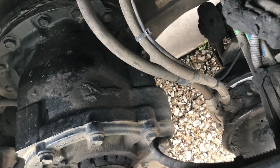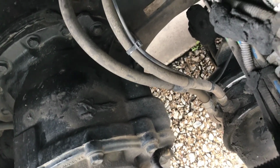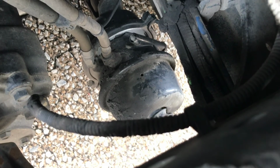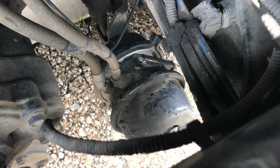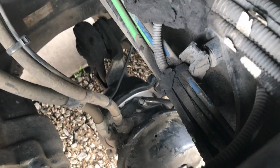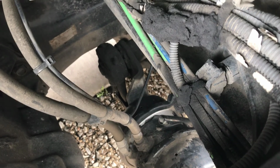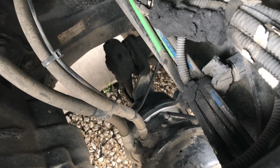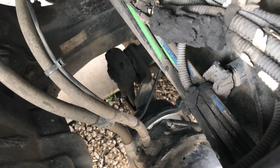Brake hose, no abrasions, bumps, or cuts. Hose and couplings are not leaking. Brake chamber is not cracked, dented, or leaking air. Is mounted securely. No loose or missing clamps. Slack adjuster and push rod is not bent, broken, or cracked. No loose or missing parts. Push rod should not move more than 1 inch when pulled by hand with the brakes released.